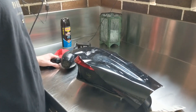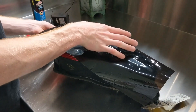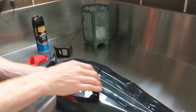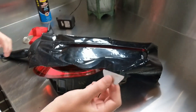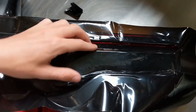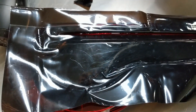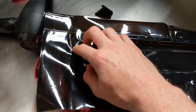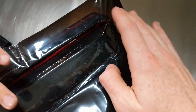Okay, we switched over to the phone — the camera died. Bit stingy, but here's what it is. So any crevices, we just want to use the heat gun for. At the moment we're just trying to put it down with my thumb as much as possible. We will use a squeegee — AKA a credit card. You want to cut around the edges to get it exact. An exacto knife would be good, but we've only got a Stanley knife blade. So you just cut on the crease of the line and hold it against the line to get as straight a cut as you can, but you'll fix it up later. Don't worry. We haven't used the heat gun yet — we just did a rough estimation with our thumb — and then we're going to cut it out, which makes it a much quicker process.